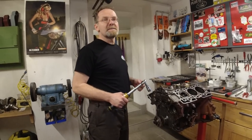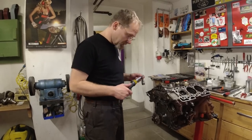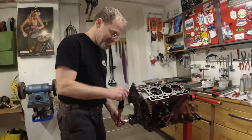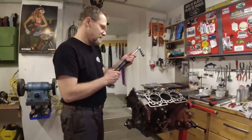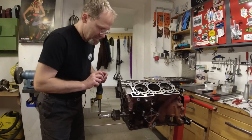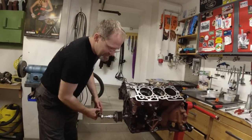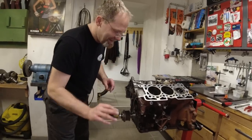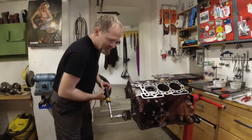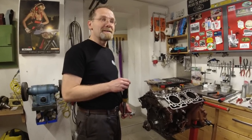Last check on the bottom end like this is torque to rotate with pistons installed. The limit is 25 Newton meters excluding breakaway torque. So we're going to start with 10. You think 10 is going to do it? No. My guess is 15. 10 is not going to do it — I'm going to go 13. I said 15. I set 13 and it's not clicking. I'm wrong, I'm all wrong. Okay, so we have to start over and I get a new guess because now I understand what you mean.